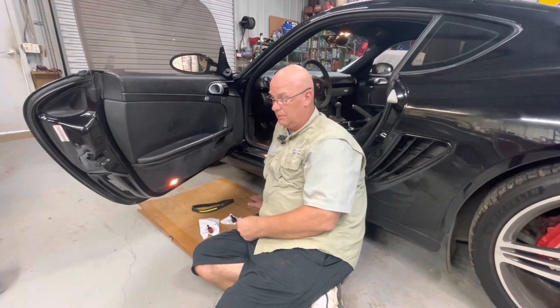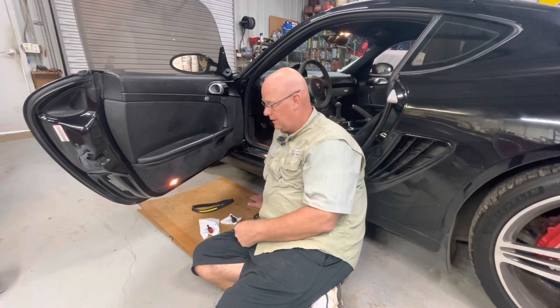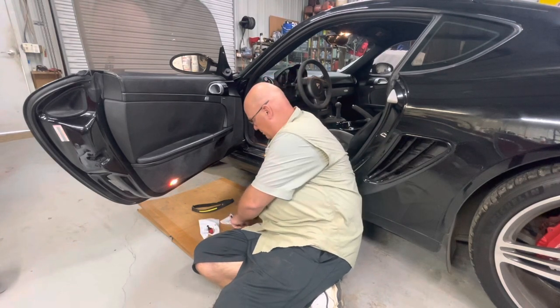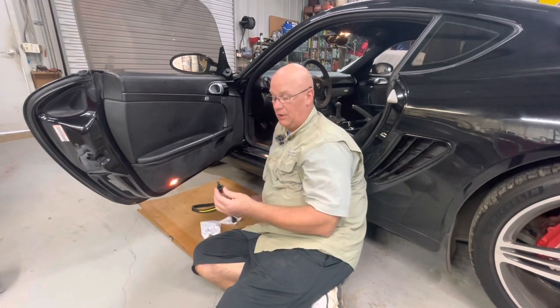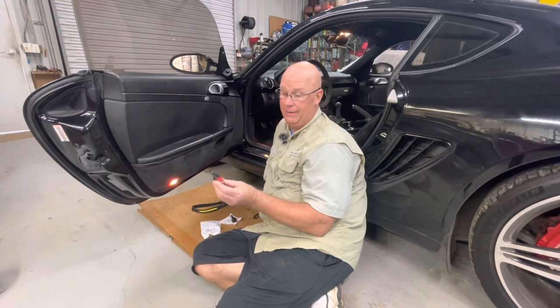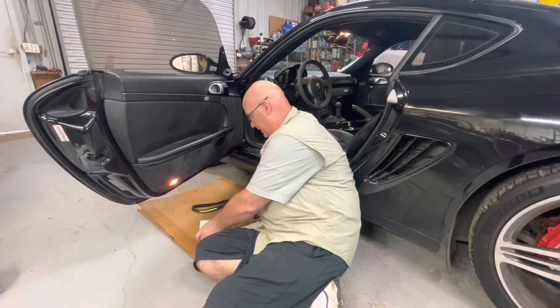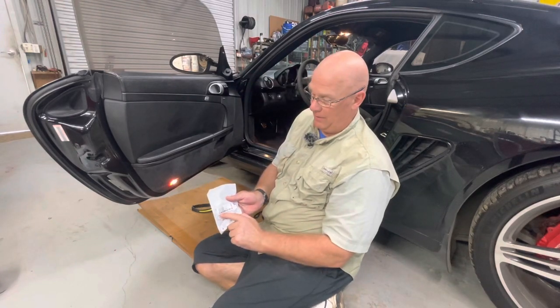After researching, you have the switch on the column — the multifunction stalk on the column. Most everything online said check out your clutch and brake switch. This is the clutch switch — it's black and red — and all it does is tell the cruise control the clutch is pushed in, which turns the cruise control off.